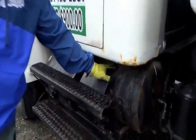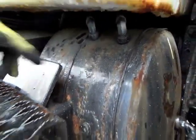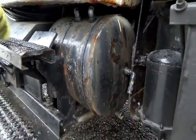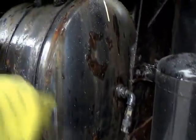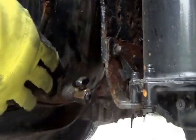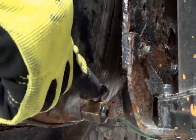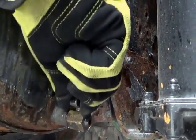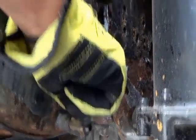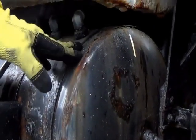Next to it is your air tank. Your air tank is not cracked, not broken, and secure, and no leaks, and is free of condensation. This is where you turn the valve and you check it. Free of condensation or water or oil. So you don't have to demonstrate it, but I want you to know where you release the air pressure, okay? So that sounds like air, no condensation inside there. Drained daily and no illegal welds.